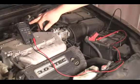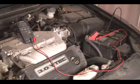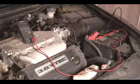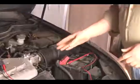What we're noticing is that it's maxing out right around 13.97 volts or so, which is well within that 13.8 to 14.2 range, so this voltage regulator seems to be working fine.